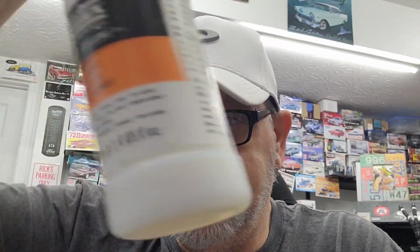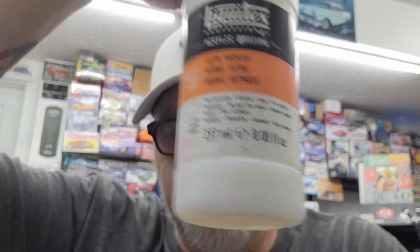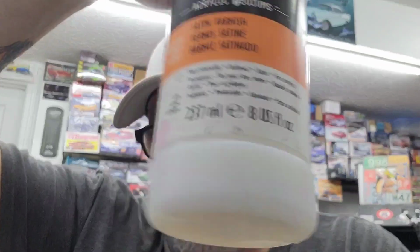Today is the day that we varnish all the frame. Anything that's black, other than the tires and wheels, of course, is going to get a good coat or two of satin. That will help protect from brushing against it, scuffing it, and wearing the paint off, so I don't have to keep going back and touching up. And it balances out. If you ever, by accident, use flat black where you needed to use a semi-gloss or gloss, wait until you're done, then come back and use one, whether it be satin, matte, gloss or high gloss, and coat everything at one time. That way, it balances out all those transition colors of black into one, so to speak.